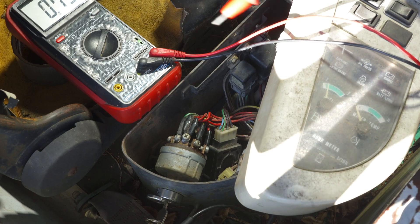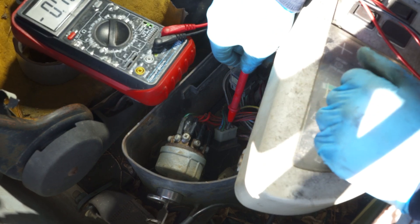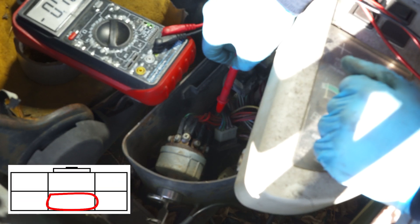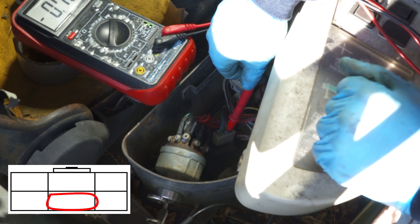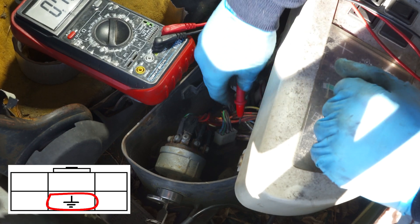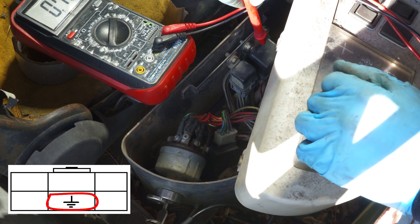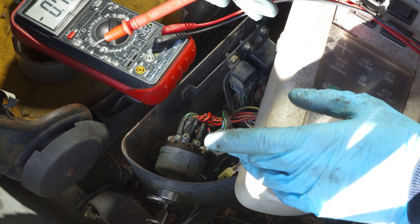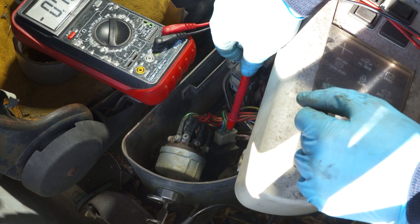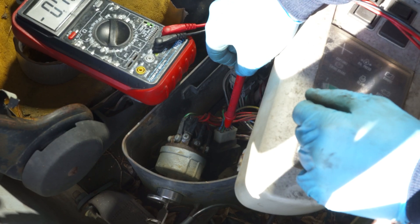Following along, tracing back my powers — the ground for the glow plug relay is this center terminal opposite of the clip. What I did was use a power probe and grounded this terminal, and then you should hear the glow plug relay energize. At that point I checked at the glow plugs and I had power at them, so that full circuit was good. That tells me that power is going through the glow plug relay to activate it, but this module is not grounding the circuit.